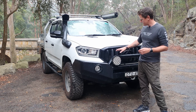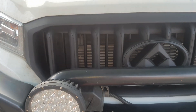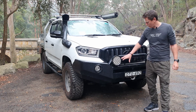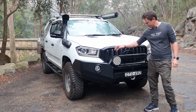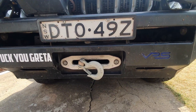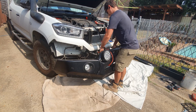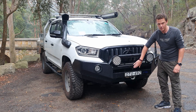First of all, with my grill — in between my actual grill fins, I used to have three different down fins, now I've only got the one. I was able to remove two of those, just allowing a bit more air while still giving the front of the unit a bit of protection. The winch control box used to sit just in front of here; I've moved that as far as I can behind one of my headlights. The number plate used to sit across the front and cover half of the front section — it's been moved down and will get onto a hinge to sit above the actual winch. The front view camera had quite a big bracket going right the way across and hanging down — I've removed all of that and just moved the camera straight onto there.